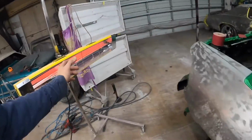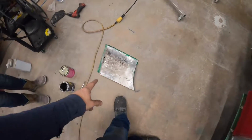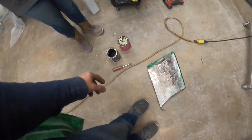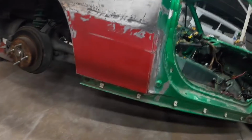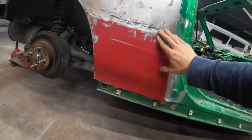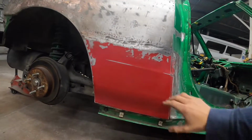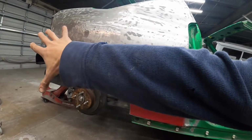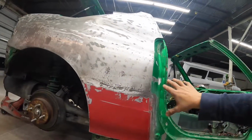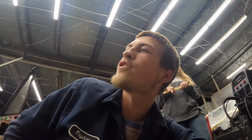All right, we're back down here. I got the light on it. We just sanded it. The wife just wiped it all clean for me. I got my mud board down here. I'm gonna mix up a little bit of long hair, kitty hair, for this spot. Since I welded it in, it's all tough. I don't really have any movement at all on the panel, so I'm really happy. But I'm gonna put a little bit there for structure, maybe a little bit through here. None in the back, maybe a little bit up there, and then I will proceed just to skim coat this thing with some regular good old Bondo, some rage, baby, rage. So let's get into skim coating this thing.